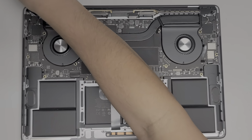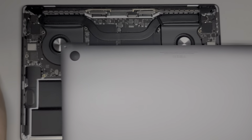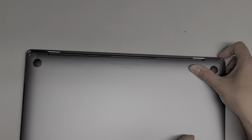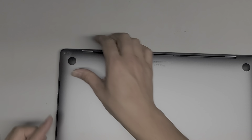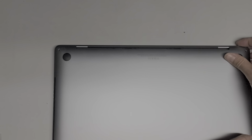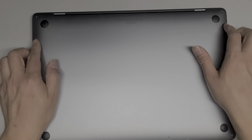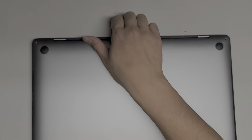Put that away. We'll switch back to the P5 or Pentalobe 1.2. To put this cover back on — it's a little bit tricky. Start with it slightly down, hold on to this putting pressure down, and slide that into place. Then go to the other side — same thing, holding this in place, slide that up. Make sure that the edges clear the metal of the laptop, the bezel. Once you make sure everything is flush all around, push on the sides and push in the center. I'm going to test it first before I put back the screws, just in case it doesn't work properly.